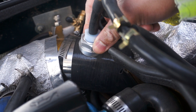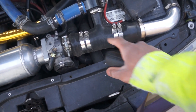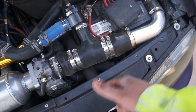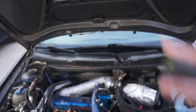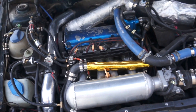From silicone intakes, they sell a port system so you can cut a hole into a coupler and it has a threaded port — so now that is a nice threaded hole. I need to buy one for the couplers down here so I can put my temperature probe, and move it post-turbo so we can actually see the IATs accurately. Anyway, that is the system. It has the return line that feeds back in here, so it basically works just like a fuel system on a car.